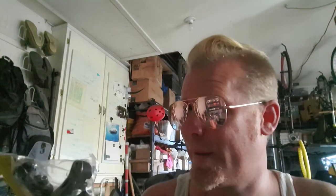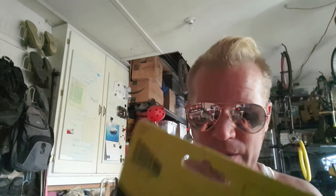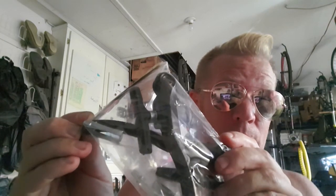Bad news: it turns out no matter how far back we take the tire, the brake support is just not long enough to clear the front of the tire. We're putting it back together with a new chain — which is better than the old rusted one — but I need new longer brake parts custom for this bike. Third bike shop was the charm: I found 135-millimeter long-arm calipers at Reseda Bicycles, versus the 100mm ones currently on the bike. Hoping that extra 35mm gives enough clearance.